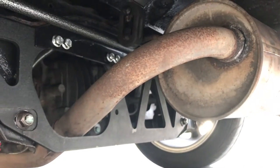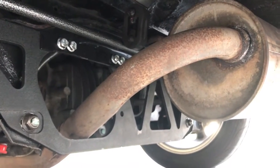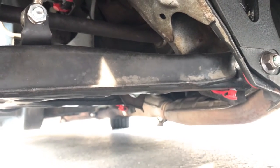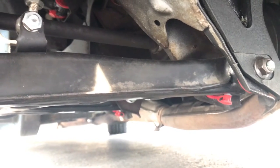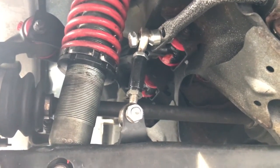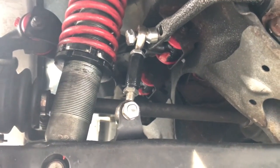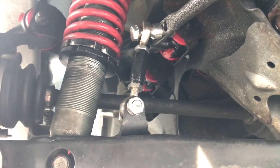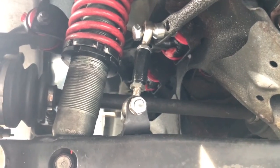For now I made one out of strip steel. Please don't mind my exhaust — it's going hopefully very shortly for a nice Fly Miata unit. Here are the polyurethane bushings. You can see those in the upper outer and the lower, and you can see where the grease fittings are. I also put dust caps on to keep them nice and clean. 949 Racing end links go with the sway bars — they're pricey, but they allow you to get a lot more out of your sway bars and dial in preload or pre-tension.